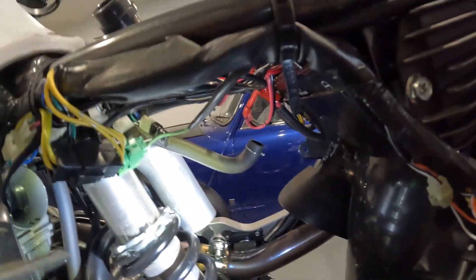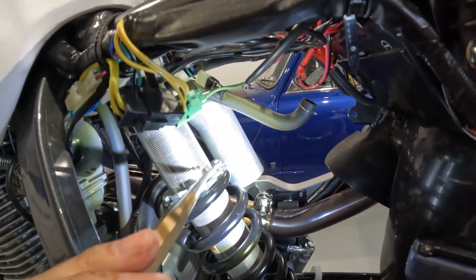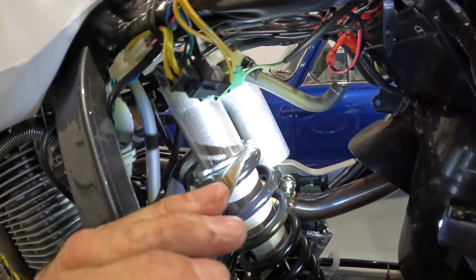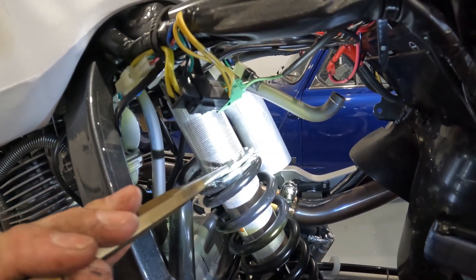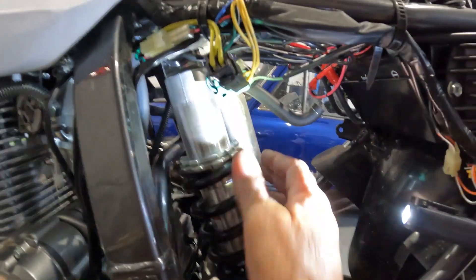The shock has a bolt in the bottom and a bolt in the top, and you can reach the top bolt through the side. I've got a flat punch and already given it a whack - you can see how you get great access to the locking ring. I just belted it a couple of times with the flat punch and the locking ring comes off, so we'll just move that locking ring out of the way.